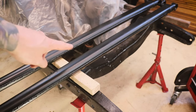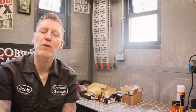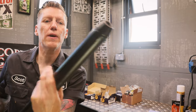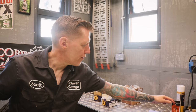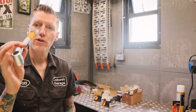I've given the wishbones and the axle a light coat of primer and black paint. It's going to be rough and ready - it's not going to see any salted winter roads and I won't be doing 10,000 miles a year, so I'm not super worried about layers and layers of paint. I couldn't help but just knock the edges off the welds - looks pretty good and super strong. I've got all my Speedway parts here, including spring perch bolts, and I've got some anti-seize to put on those so hopefully they won't be such a nightmare to remove in future.